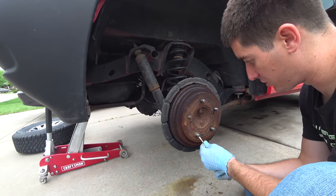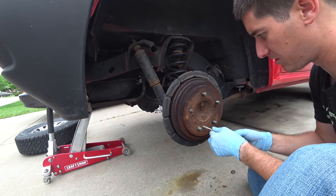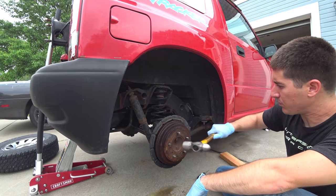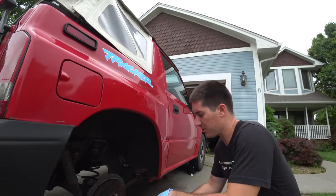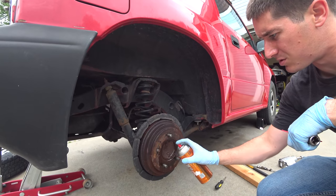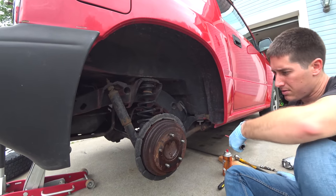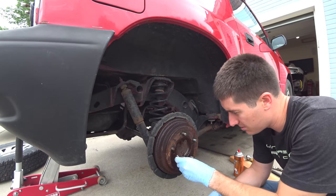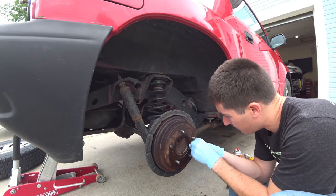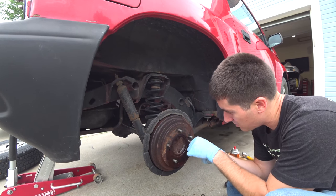There's one. This one has two retainer clips on it for some reason — it should definitely have only ever had one. I think somebody just put them both on one side. It doesn't need these retainers anyway. We grabbed some CRC knocker loose — we're going to soak this. Hopefully that will help break the rust free. Hit all the studs since we're in here, and then shoot the bolt removal holes. We're going to try to force it off with a bolt because it's not wanting to come off. The holes are full of corrosion and junk, but as long as we can get this bolt started in one of these holes, we'll be okay.